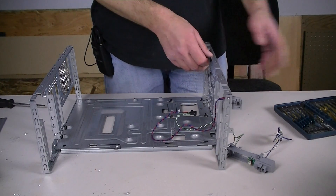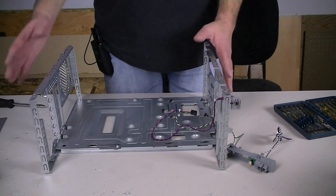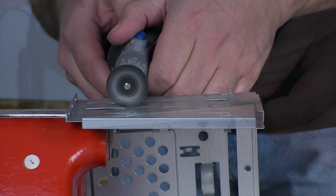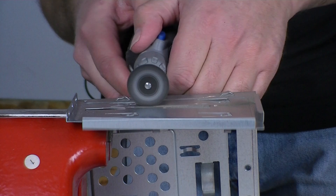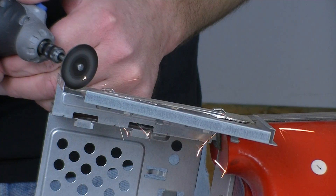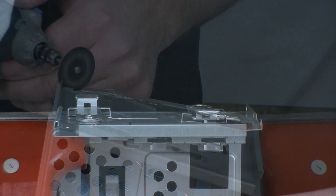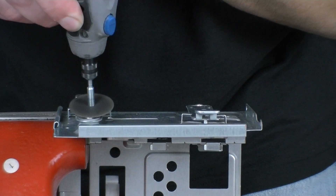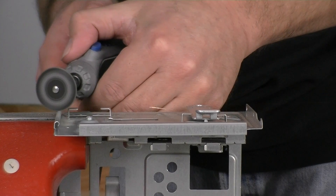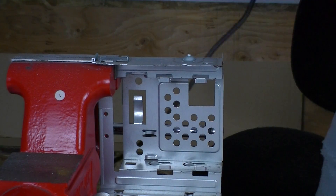Now that it's apart, I should be able to cut the blowhole for the radiator fan quite easily without having to be inside the case. For our mod to work, we're going to have to make a few adjustments to the chassis. The first one will be adjusting this cage to allow for the radiator fan to fit. I still want to use a card reader, and I have this NZXT unit here that I believe will work great, although it does need a 5-1/4 bay to operate. The inside of it is pretty shallow, so the fan will fit in here and allow for installation. We're going to take a Dremel tool and basically lop these two pieces off. We need about 3 inches of clearance from the top of the case to the bottom of the fan to make this work. We'll be using reinforced Dremel cutoff wheels — these are great because they last a long time and are really strong.